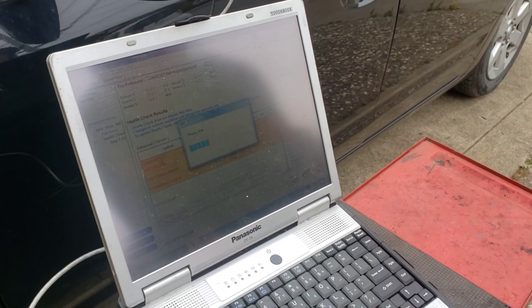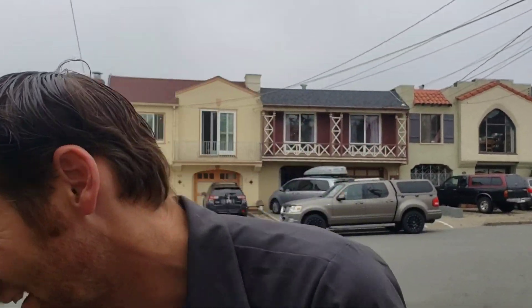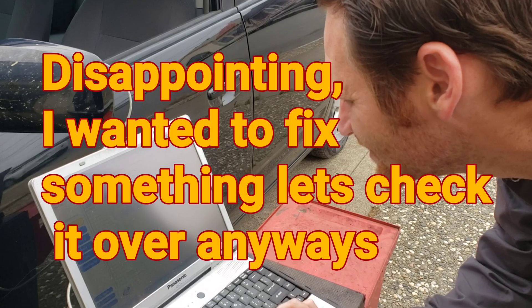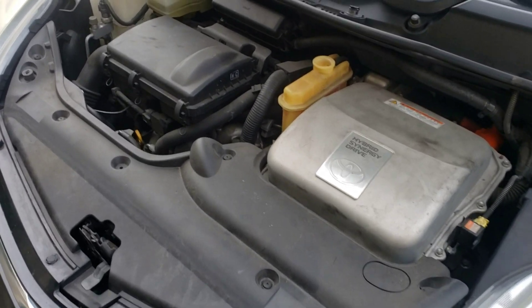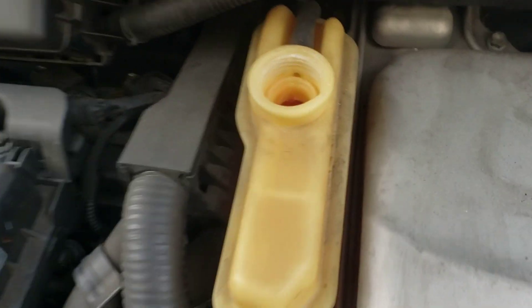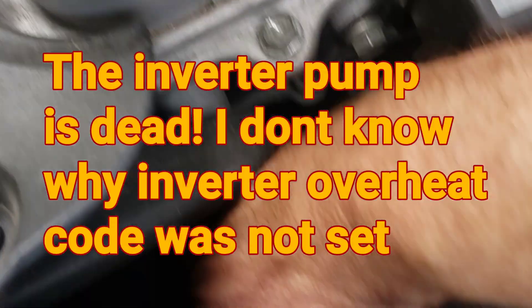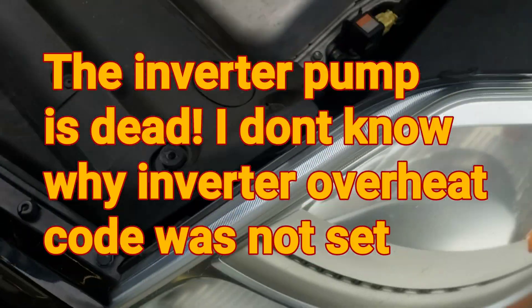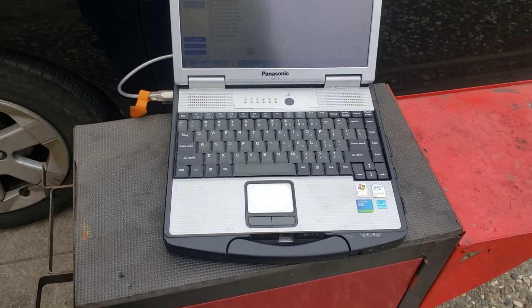Not what I expected. I thought we'd have some hybrid system errors — fuel run out? Oh my god. This is quite odd. There are no hybrid system errors, but as I peer down into the inverter reservoir, it is not moving. That inverter pump is dead. No cavitation — if the inverter pump's not vibrating, it is dead.